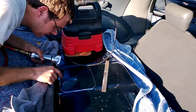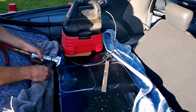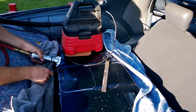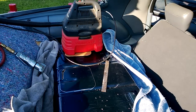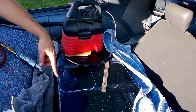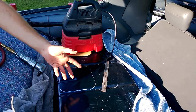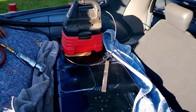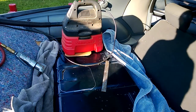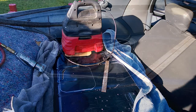I'm looking in there and I can see that I'm in a pretty good spot. I can see the ring is right about here, and I can see a plug right there too — it's really, really close. So if I used my cutoff wheel, I'd have to be careful there. That's actually not a bad line; I guess once you get it going, it works better. So that's what I'm going to do. I don't know what I'm doing for a patch panel yet. Obviously I'm not going to use this piece because I'm cutting way in and I'm going to trim out. I'll probably get a piece of galvanized steel, put a couple ribs in it, and then figure out how to seal it back up — either with an actual sealing strip or I'll probably just use RTV. I don't expect to get back in here again anytime soon. I'll maybe start the video up in a couple of minutes once I get the hang of this thing — I just wanted you to see what I was doing and that I don't know how to use that tool.